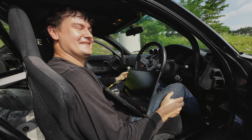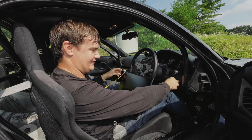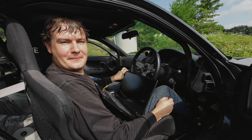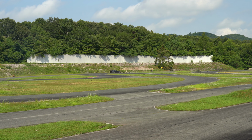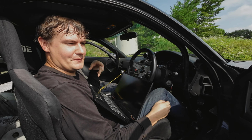Bihoku. So we were a little rushed this morning. I just went out for a free session just to check the nerves off and everything, but did one lap and then the car turned off and wouldn't start again. I couldn't hear the fuel pump, so I had to get pushed back in and just confirm we don't have enough fuel pressure to run the car.